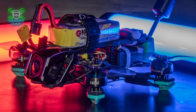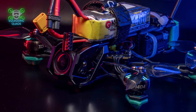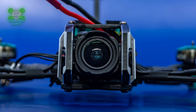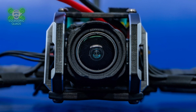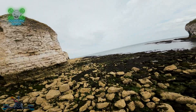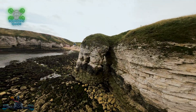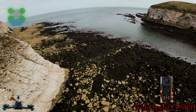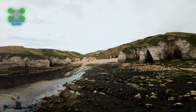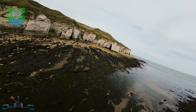What is the Oasis 25? In short, it's a 2.5-inch FPV freestyle drone, but in reality it's a little bit more than that. Looking at the spec, we've got 1404 4,500 KV motors giving you a 4S configuration - you could step down to 3S if you're a more novice pilot. We have an F7 all-in-one flight controller with inbuilt ELRS of either 2.4 GHz or 900 MHz. Weight without battery comes in at around 171 grams. It's offered in a plug-and-play version where you can add your own O3 - it also fits Caddx now - with a TBS Nano or ELRS. They recommend a 4S LiPo between 530 and 730 mAh with an XT30, and it comes with HQ props.